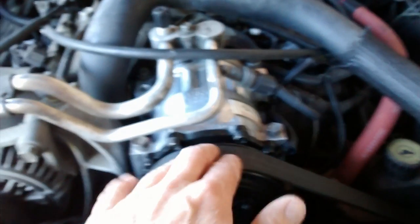Okay. Air conditioning. Mine stopped working, even though it was charged. I didn't know what was wrong at the time. I just bought a kit that came with a compressor, an accumulator, PAG oil, and the orifice valve. So I went ahead and replaced all those while I had it apart. Compressor, I should have written down the model number. It seems like a good one.